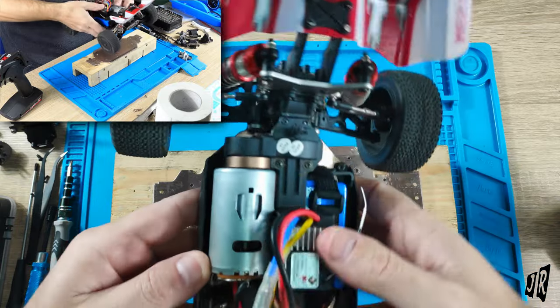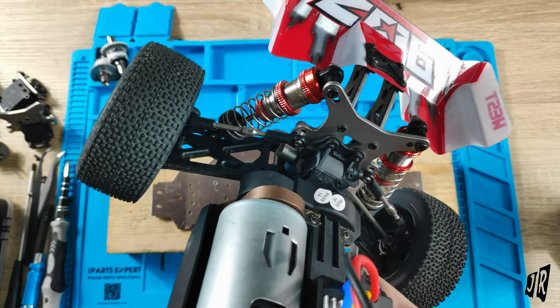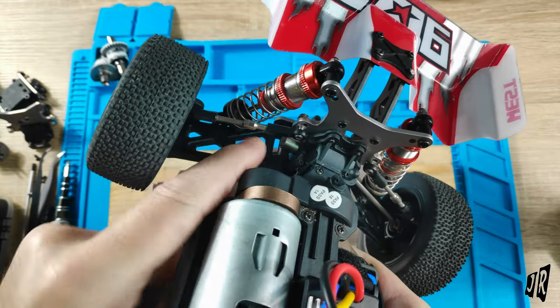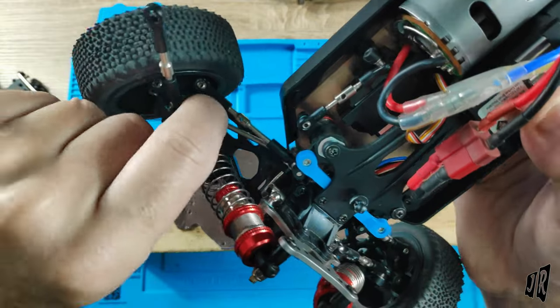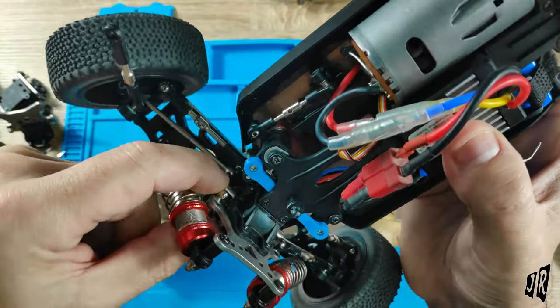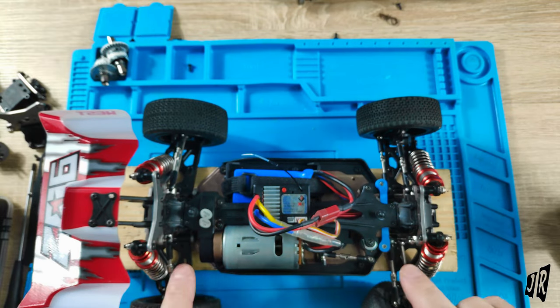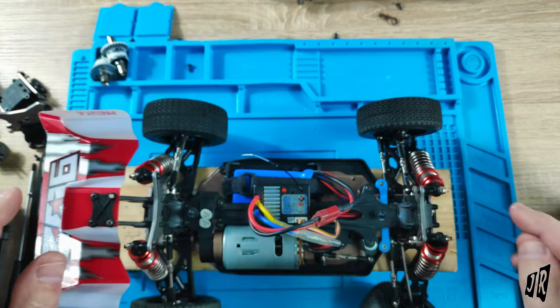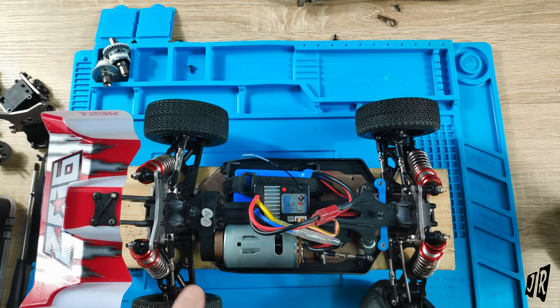To get you updated, the rear dog bone drive shaft is being taken out, and the same on the front, because I want no resistance here. Okay, I just want the other side to be running. Now, obviously, both sides take a little bit longer to get up to speed because, obviously, this side's just spinning. But watch what happens.